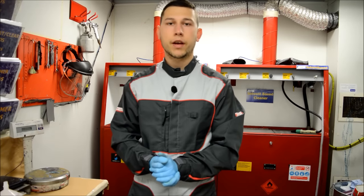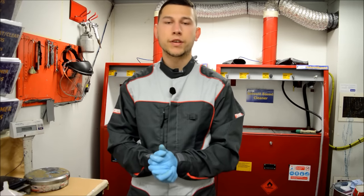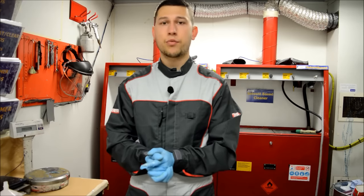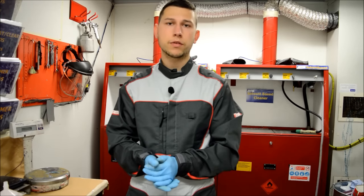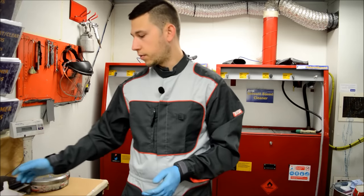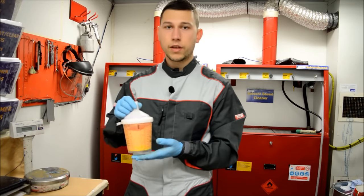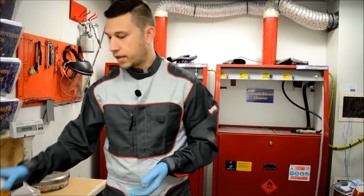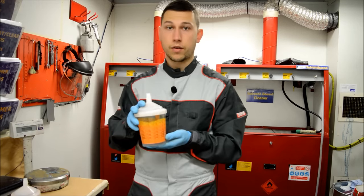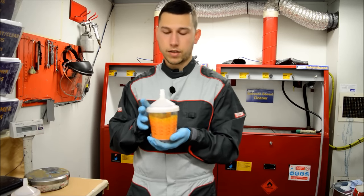Hi, I'm Jordan and today we're going to be painting Ford Electric Orange. As you probably know, this is a three-stage colour which means it requires a ground coat, a pearl coat and a clear coat. We're going to be starting off with the ground coat — this one's quite a light orange — and then we're going to be going over it with the darker colour which is the pearl coat, and that's stage two.